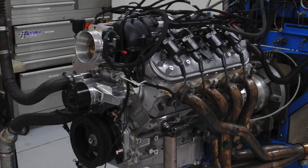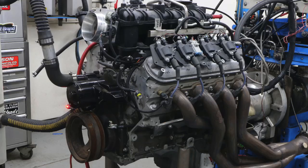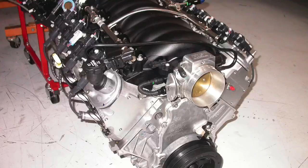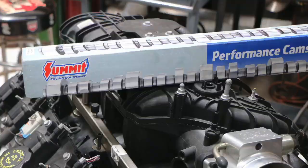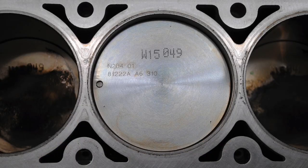Okay guys, what do we learn from this video on our upgrades made to the 6.2 liter all aluminum LS3 and the equally all aluminum L92? Well, we learned the following thing. If you're going to make an upgrade either to the LS3 or the L92, the thing that you should be thinking about is camshaft. That's right, both the LS3 and the L92 already have basically everything else that they need. They've got plenty of compression, they've got displacement, they have really, really good cylinder heads, and you notice that I used 2 reallys there because the LS3 basically is kind of the high water mark of what I call the readily available factory kind of LS motors.